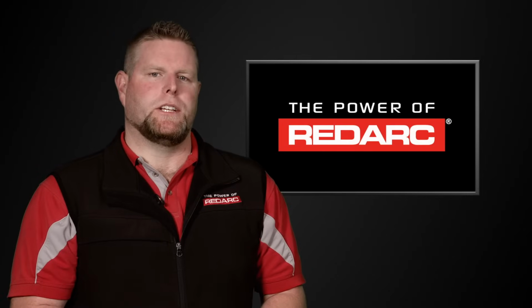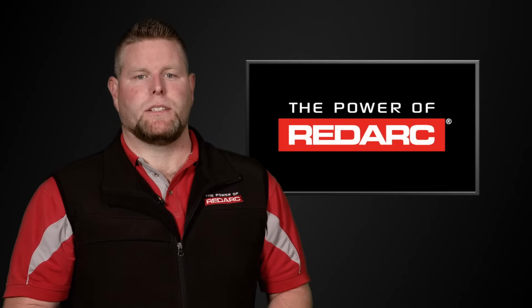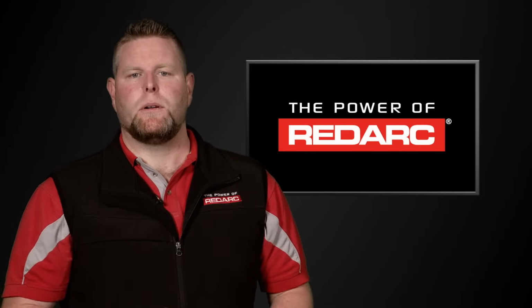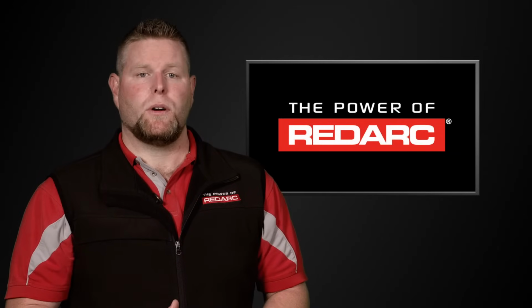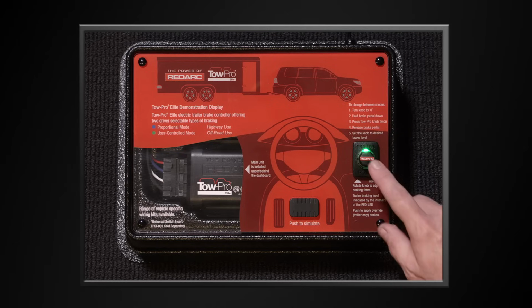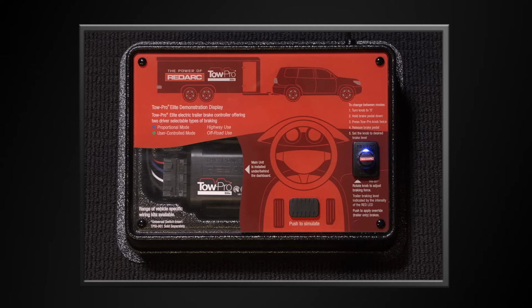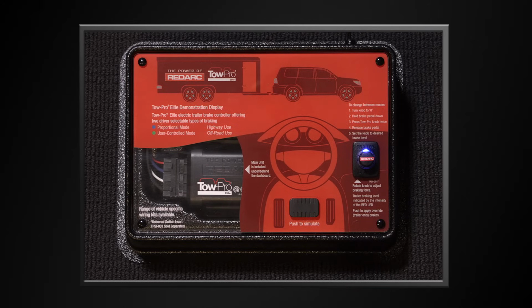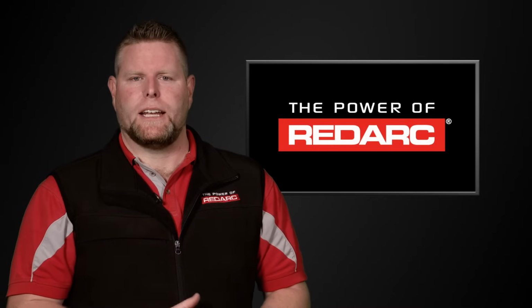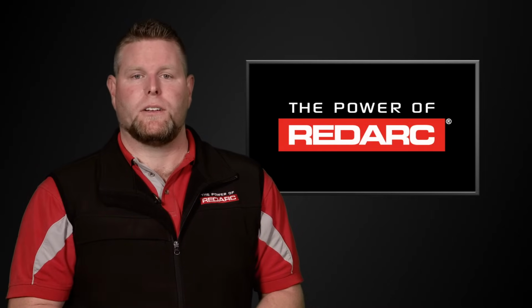The Tow-Pro Elite also features manual override. This feature is designed to brake the trailer independent of the vehicle and will also bring on the vehicle and trailer brake lights. Manual override can be applied in either user-controlled mode or proportional mode. In user-controlled mode, it comes onto the level that has been set. And in proportional mode, the override braking is applied to a level that equates to a moderate braking on the trailer and regulates the amount of pressure to make sure the trailer is pulled straight behind the car if it gets any sway. This feature is particularly handy if you've gone past a semi-trailer or other large vehicle on a highway that may cause instability in the trailer.